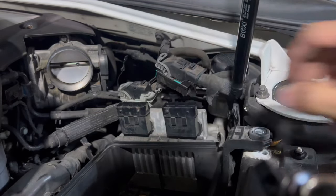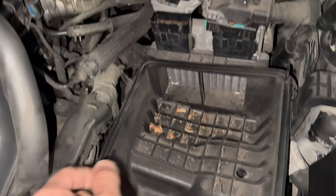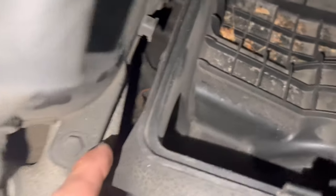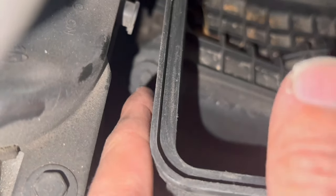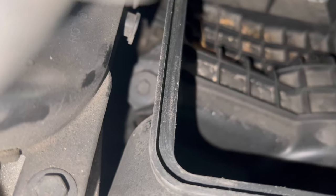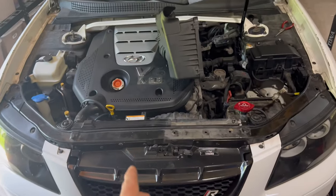That's how you remove your ECU. Now we're almost done taking this out. Remove these two, then go ahead and remove that bolt right there — it's a 10 millimeter. Remove it and then you're able to lift this up.